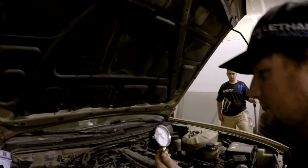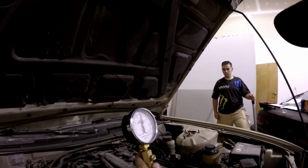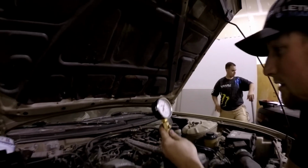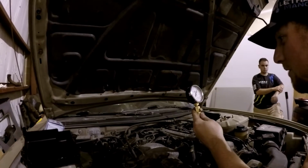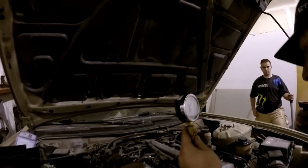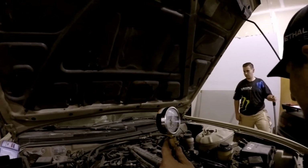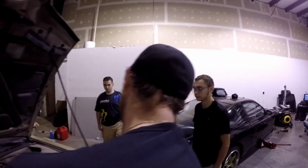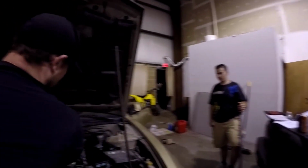My hand was on the fan. Keep going. Good. Dude, that thing's almost at 200. That was 190. That had all the oil in it. Yeah. If you're making good compression regardless. If you're almost at 200, this motor's good. Yeah. Even awesome, with oil.